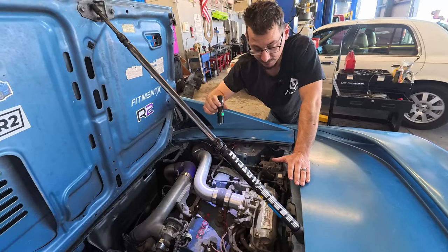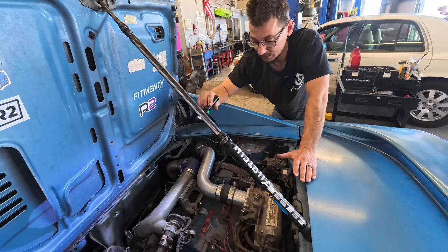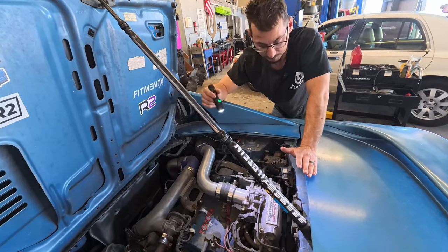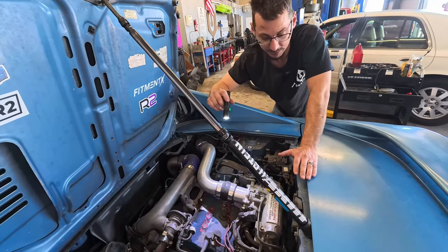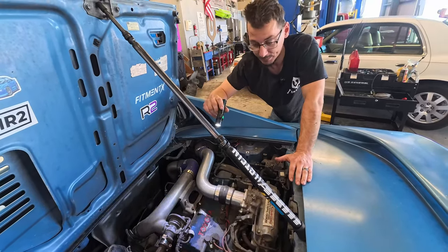It's the other thing too, if it doesn't do much, is the intercooler piping, everything like that, solid? So we might smoke it and see if there's a hose somewhere that's leaking, because these things are very temperamental, being an OBD1 car.